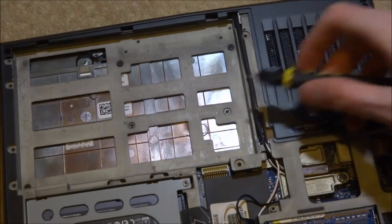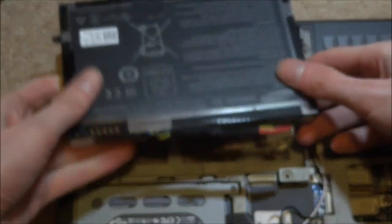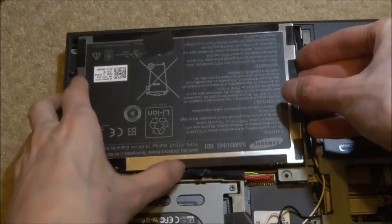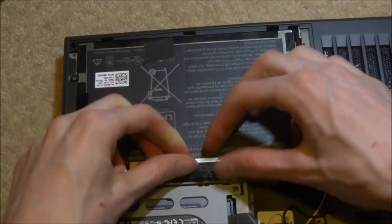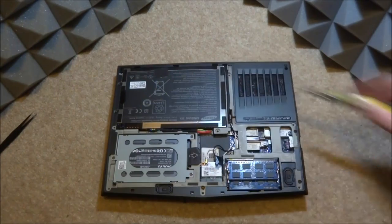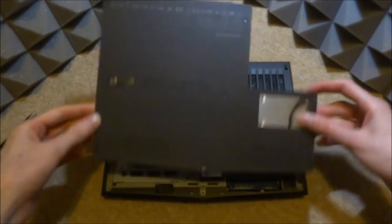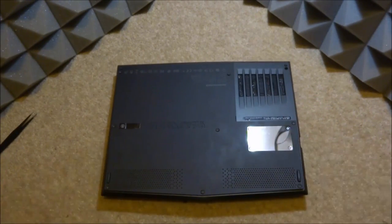Before putting the battery back in, place the two screws back in their spots. Once those screws are in, clip the battery cable into the port first, then rest the battery in and push it down the side. Clip the battery back in, and make sure to push the hard drive cable back in as well. Now put the two battery screws back in. With the battery screws done, it's time to put the bottom panel back on — start from the top where the clips are, slide it into the tray, lay it down gently, and do up all the screws.